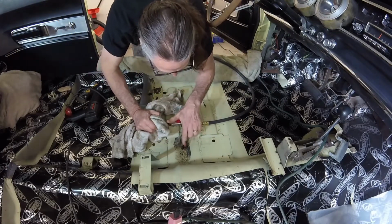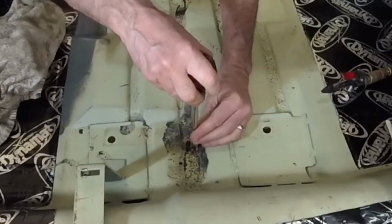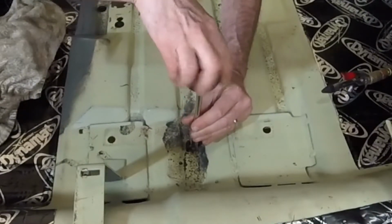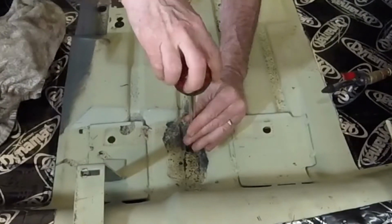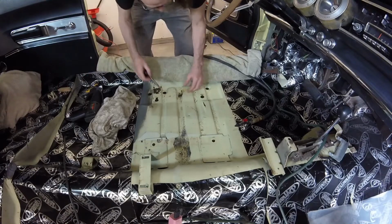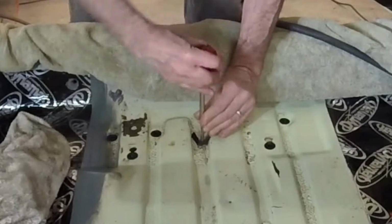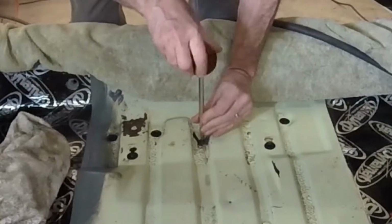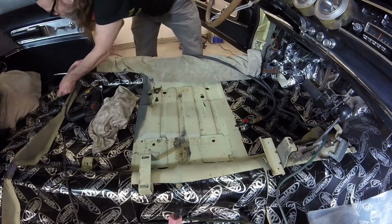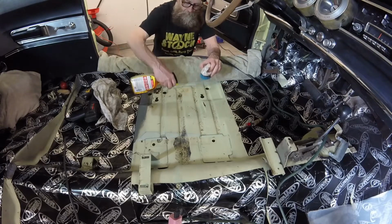I had assumed that the wire harness's hold-down tabs were spot welded to the floor pan, but after scrubbing them clean, I saw that they each had one sheet metal screw attaching them. I temporarily removed the screws and hold-down tabs to simplify the Dynamat installation. This also allowed me to clean underneath the hold down tabs.